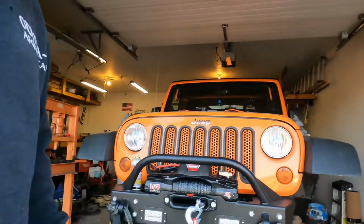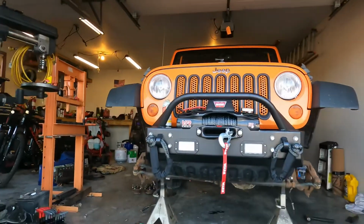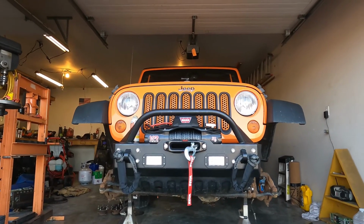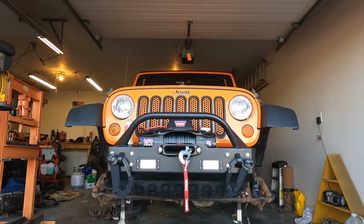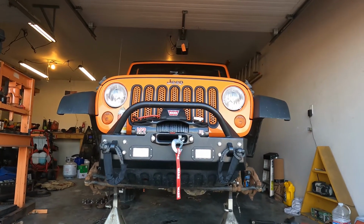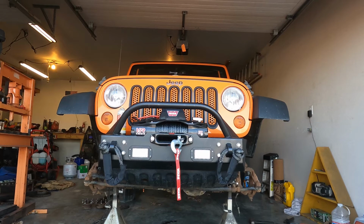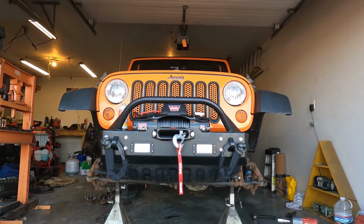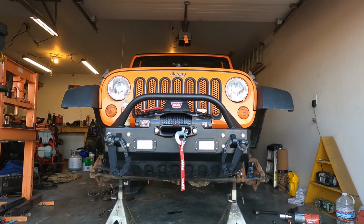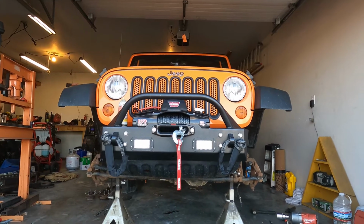We've got the Jeep apart. It's kind of a wreck. Hopefully you can see that. This is what I'm working with. Nothing underneath in the front, and both sides are completely torn apart. So that said, next step is going to be taking the differential cover off and draining the oil out of it, and getting that center section out. So we'll start working on that.